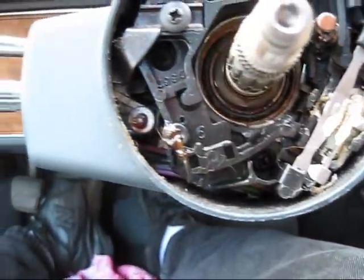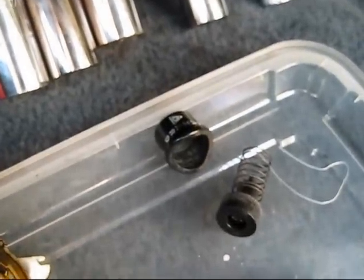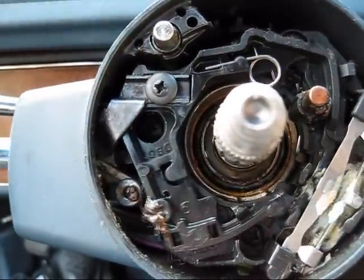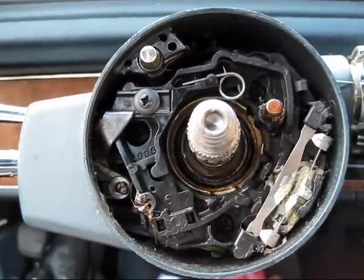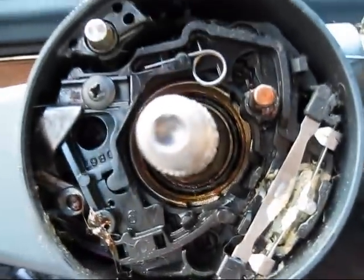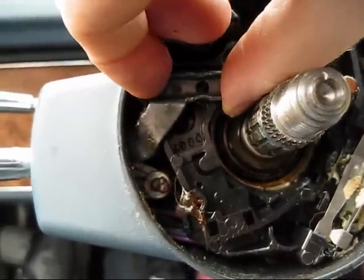It looks like we've got three screws holding in the turn signal switch, and I'm probably going to have to take that off too. I removed my hazard switch — it's just one little screw that holds it in. There's a spring and another external piece out there. What actuates the turn signal switch is this little thing right here. And what's interesting is I'm missing a spring here that's for the left-hand turn signal cancel, and that's why my car doesn't cancel when I use a left-hand turn signal. So maybe we'll find a spring in here somewhere. I'm going to remove this screw and then pull this arm out. I remove the screw, and then this just slides out like that. So now we've got to deal with these screws right here.